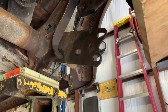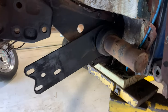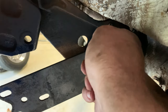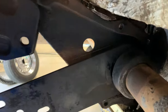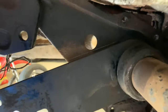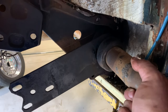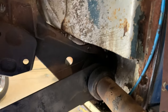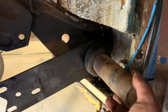From the backside, we're just going to tap this out just a little bit. There it goes — popped down there. Now we can move it on out and adjust it. I went ahead and sprayed a little black around there and I'm going to scribe the mark where we're at right now — put a few nice lines down to the metal so I've got an original mark to go from. If we lose our spot, we know where to go back to. Now we're going to pull it out just enough to make it drop off the splines. You've got inner splines and then outer splines. You can move both of them, or just the outer, or just the inner.